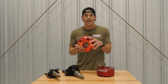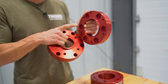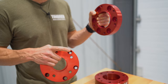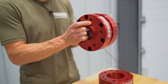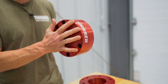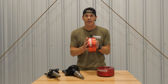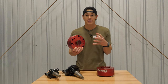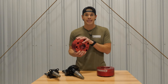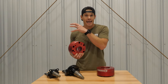This is the brand new wheel adapter and it's designed as a two-stage adapter. Stage one is going to mount to the trailer side — it mounts to your wheel end kit — and then stage two nests really nicely with a perfect snug fit. This is where you're going to mount your wheel with that five-on-five Jeep bolt pattern. Timbren engineers specifically designed this wheel adapter to work perfectly with an axless trailer suspension and a Jeep wheel.